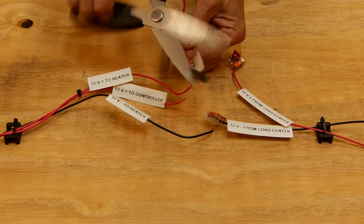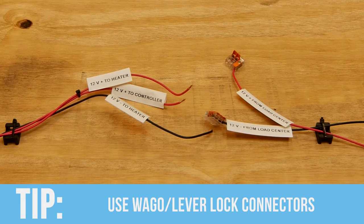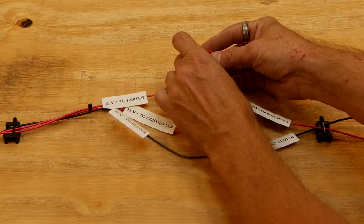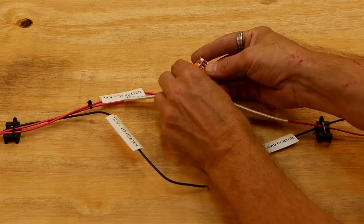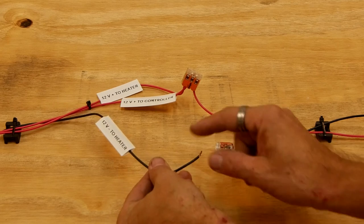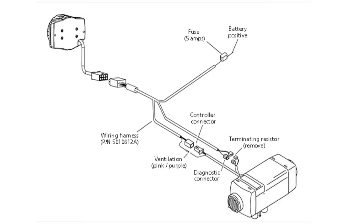Find the opposite — controller side — of the smart temp retrofit harness and route it to the location of your existing rheostat controller. Once routed, disconnect the black four-pin connector from the back of the rheostat controller and connect it into the retrofit harness. Then find the red wire from the main wiring harness with the bare end and crimp it onto the butt connector supplied on this wire from the retrofit harness. Now connect the larger black connector to the Smart Temp controller. A useful tip: we often run supply wires to the heater location, cut off the ring terminals from the Webasto wiring harnesses, and use Wago lever-lock connectors to bridge our supply wire to the Webasto wiring harness wires — bridging the 12V positive supply to the heater harness and the 12V positive on the Smart Temp controller, and likewise for the 12V negative.